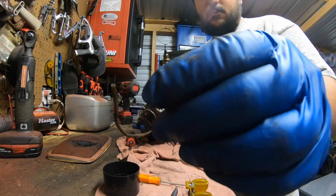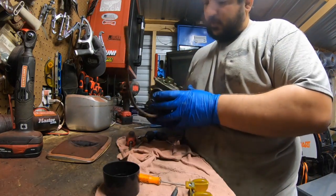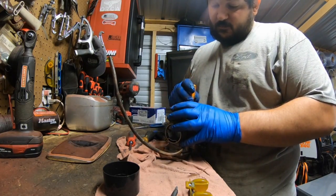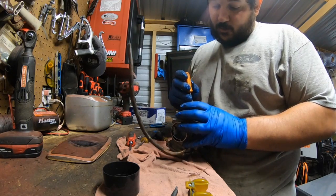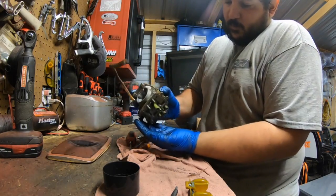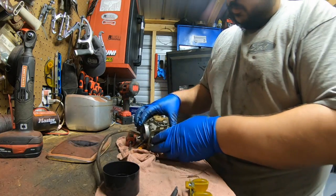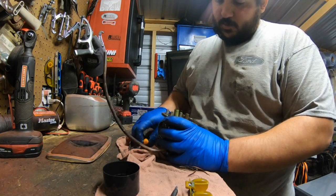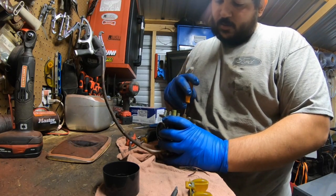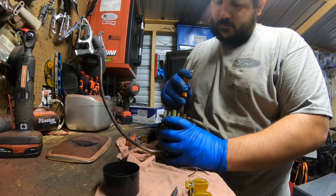Yeah, just look at that. Would you just look at that? Okay. Sometimes I try. Yeah, you can't. The rubber washer and the metal washer stuck down in there. Oh, we had it. There's the metal washer. A lot of people don't realize those are in there, and what happens is you actually get leaked by and the machine won't run right.